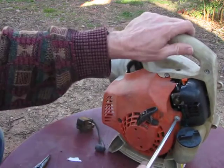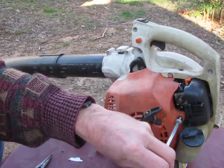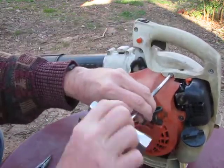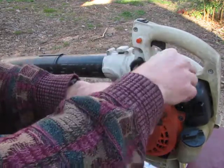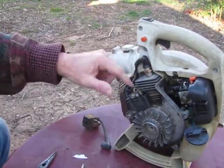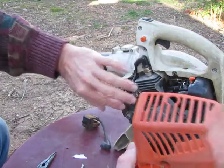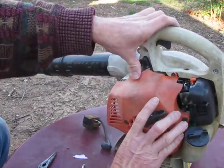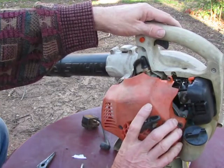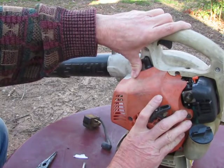I'm gonna tell you, this is probably about a 7 or an 8 on a scale of 1 to 10. Not because it's that much work, but just a bit of technical involved here. Okay. You know, it comes right off, but again, this cable's got to be just like that, and it'll get in your way because these fins here touch up against these pieces. Just like that. Now it fits right on. I was struggling with it earlier though, you saw. And you'll say, but the OEM coil fits no problem. No, I know, but they don't make it anymore.